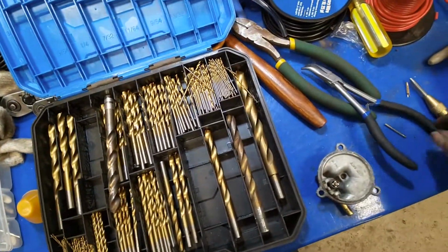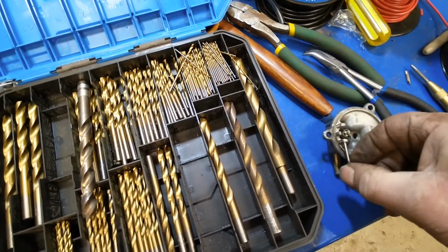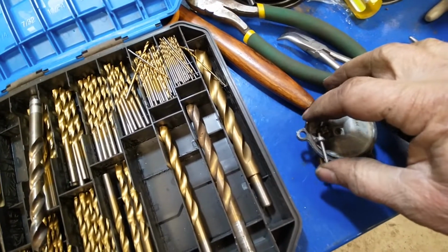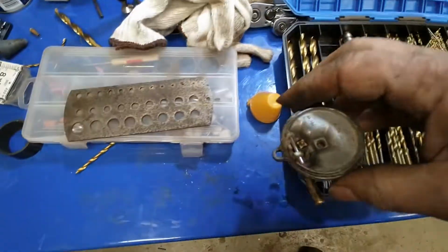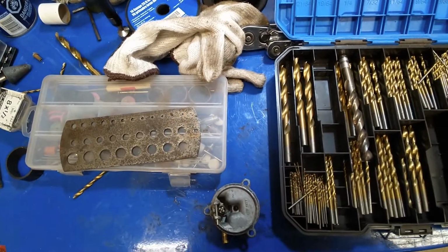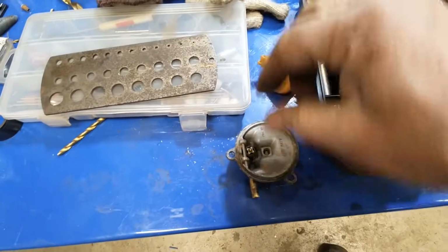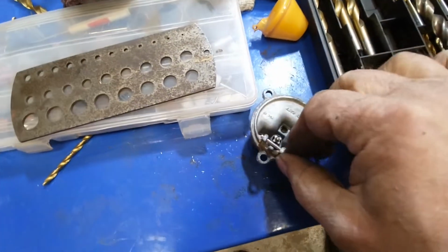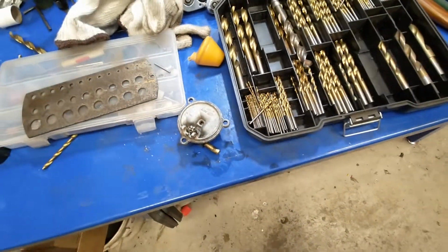the new pin fits in. And the new pin will go in, and that'll hold that float assembly on. And I didn't hurt the float assembly in any way, I don't think. And I'll be able to get a new needle and seat in there that I have, and also adjust it up with that adjuster. So, hopefully that does it. I'll check it out, see what happens.